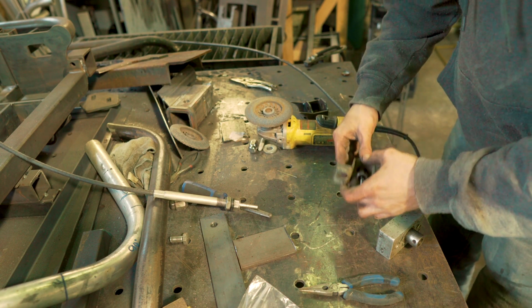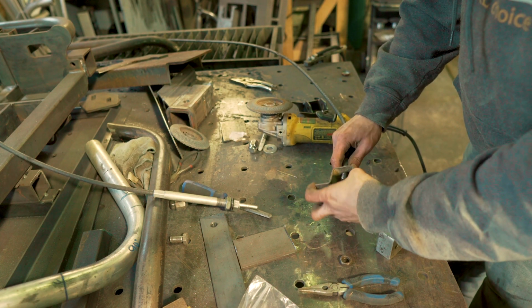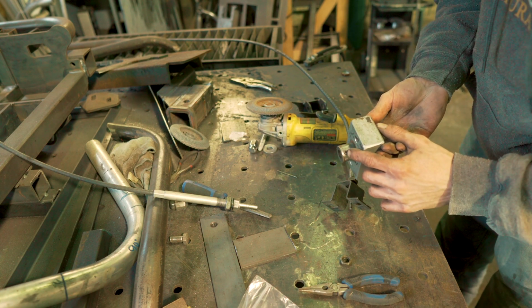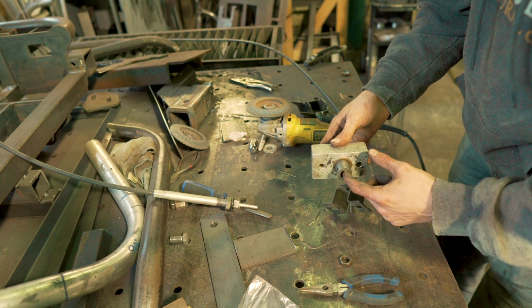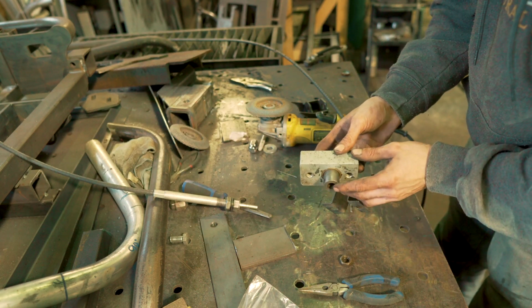Alright, you guys have got to check out this cable actuator I picked up. I'm super stoked on how simple it is. So this is the plunger, and there are two tiny little Allen head screws here. What we do is back those off and then tighten them on the pin that's inside the diff. So that'll go in there, and we'll tighten these on so it'll be attached.